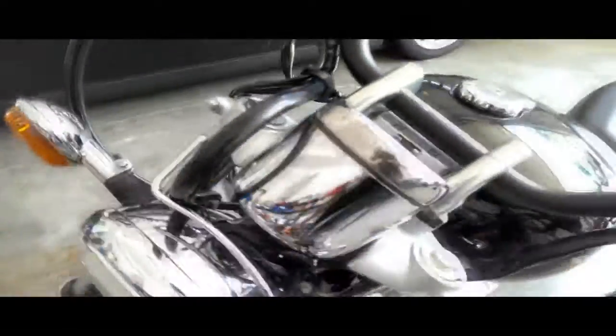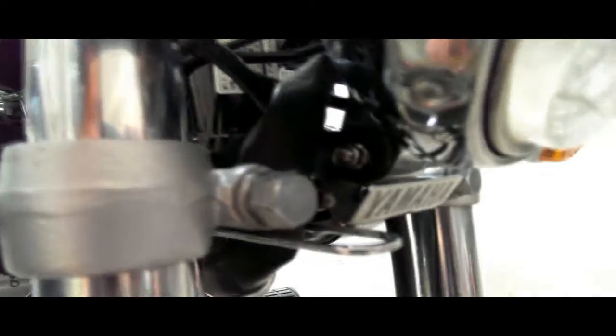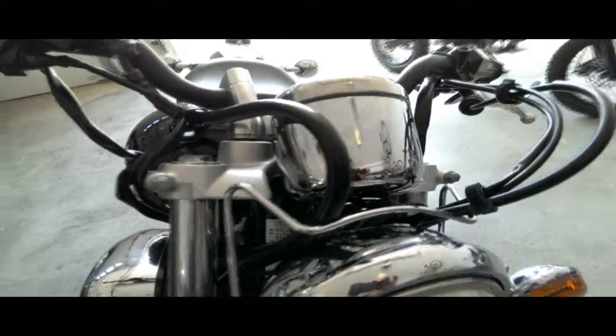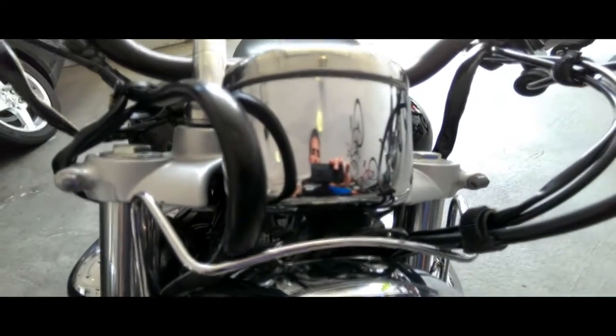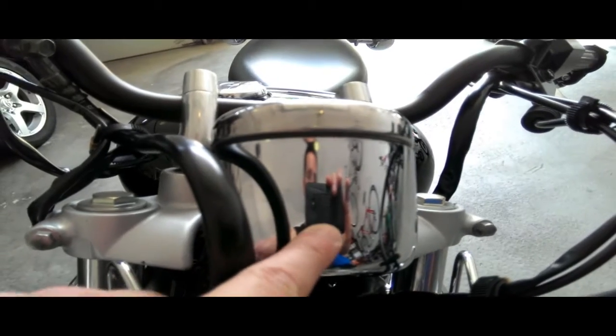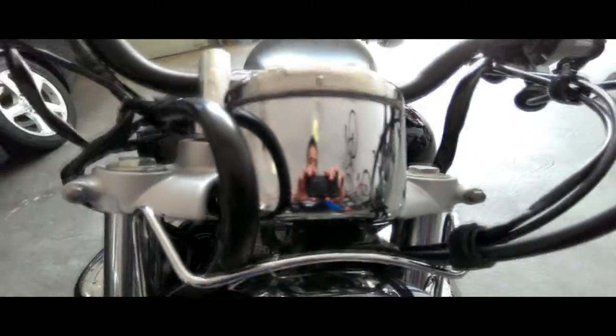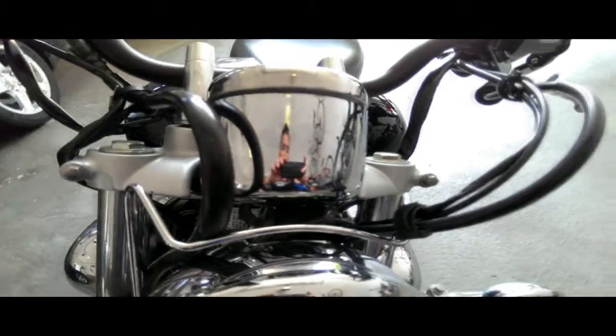It's really simple. There are two Allen screws — one is right there and one is on the other side. You loosen the headlight bolt to swing the whole thing out of the way a little bit, then remove those two Allen screws. The bezel has one Phillips head screw on the back, and the whole bezel separates. You pull out one little plug and there's a tiny little bulb.